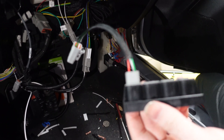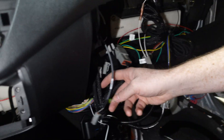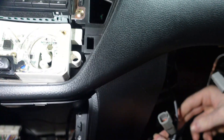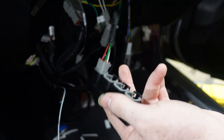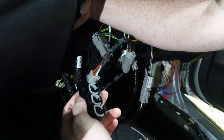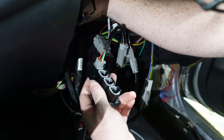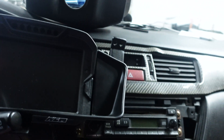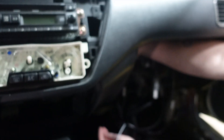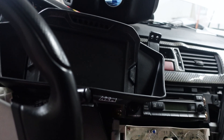That's what it's going to look like plugged in. Where it sits and locates is going to be behind that plastic column right here. Right now we are plugging the ECU into the four channel CAN — that's done. The next thing we're going to be plugging in is the VDM, which is connected to the dash. The VDM has a Y on it, and then that will go right into it. We're also going to be plugging in our six channel CAN that we're installing today.